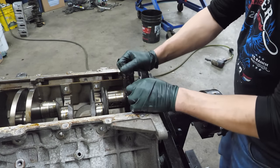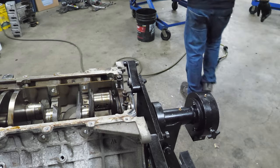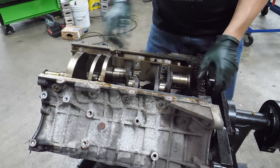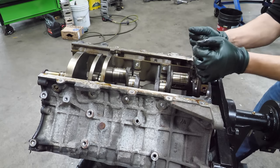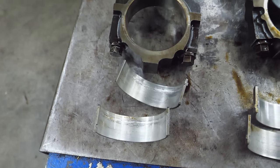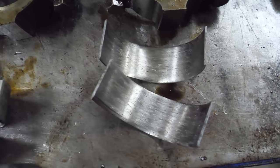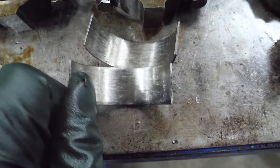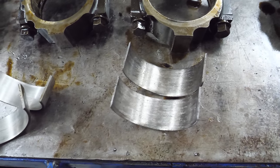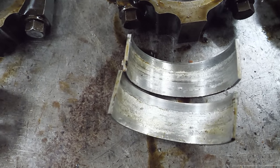After some sketchy hammering, the rear main seal plate comes free. Now I can try to lift the crank out. The crank lifts right out. Looking at the rod bearings - not good. The offending one is quite a lot thinner and distorted, especially the top shell. There was honestly more bearing material there than I expected given how much movement it had. The adjacent cylinder's bearing is rough as well. Several others show wear, and one more was coming apart.